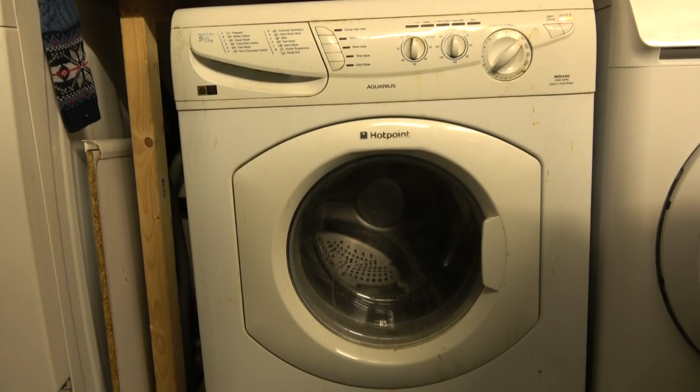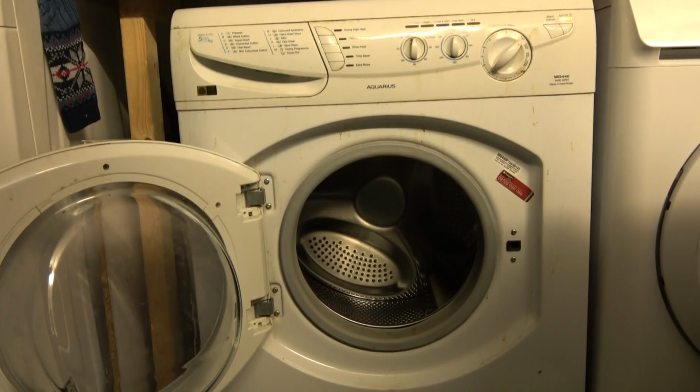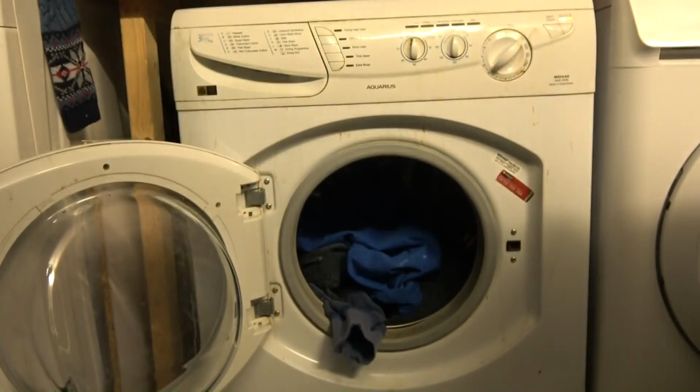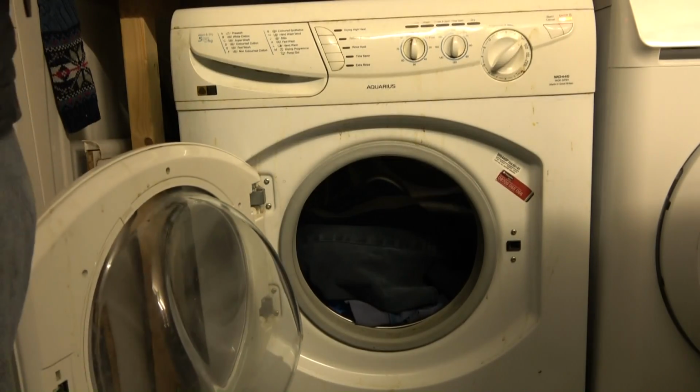Right, so that's this WD-440 that I got a few years ago, about 2 years ago, which my uncle gave me in exchange. He gave it to me and I sold him a Zanussi Bendix AW1001, and a new ZWC 37100 back, because they wanted a separate washer and dryer rather than a combined one. Also, they thought this was just a washer anyway. Apparently they gave it to me in full working order, but when I spun the drum I noticed there was some bearing noise. It's been sat 2 years, and the bearing noise is slightly worse. Not totally worse, but the bearings have gone, so they need replacing.